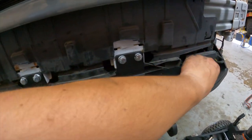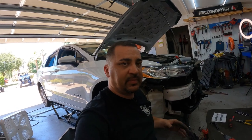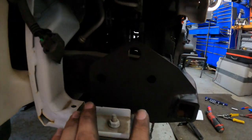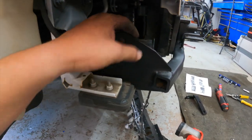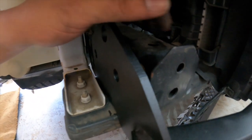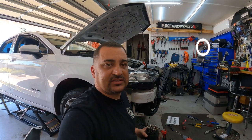I've got those four bolts done — not going to lie, that's probably the hardest thing I've done so far, just getting the nuts lined up behind there. I did pre-screw the bolts in to make sure all the threads are nice and clean. Now I will go back and trim these off before I put the bumper on. Next step: we're moving over to the side. We're going to do this on both sides. I'll show you on the passenger side — you've got these two holes here. You're going to take a half-inch drill bit and drill all the way through.